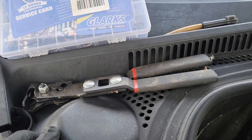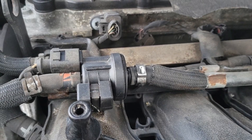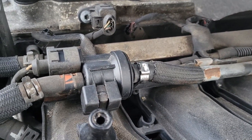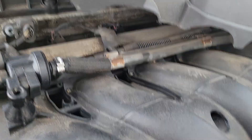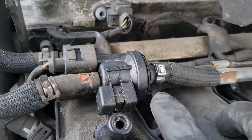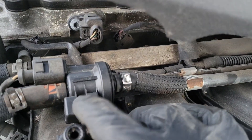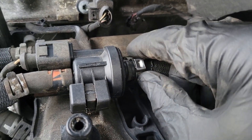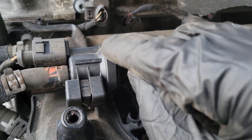I'm going to put the hoses back on and show you the clamp install. I have a used valve from a motor I preemptively grabbed at the junkyard about a year ago — this engine has 385,000 miles on it and is still running strong. I pulled this valve off the complete engine from the junkyard so it's used, but it still holds vacuum and actuates properly. Once the valve is back installed, get your hoses back on. Put this type of clamp on the hose first, then slip the hose onto the port of the EVAP purge solenoid.